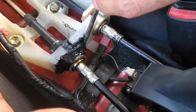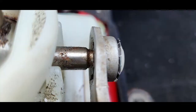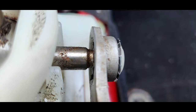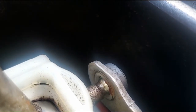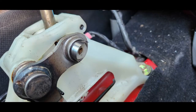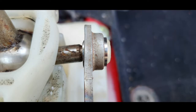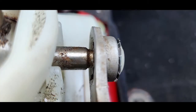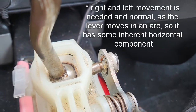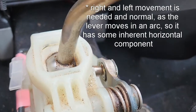By now I've driven with this modification and I'm much happier with the downshifts, but I can still do better. When moving the shifter to the right and left endpoints, especially reverse, I noticed that the bushing in the crossgate lever is worn out slightly and moving up and down. This needs to be fixed before I continue to make the shifter plate. Instead of replacing it I tried this method: I have some scrap feeler gauges and found one that can just barely slide into that opening. I cut out a semicircle and pushed it inside — I didn't have the right size for a full circle, but this will suffice. I then cut tabs into the ends of the strip and bent them so it can't slide out. This fixed the up and down play almost completely, which translates to a few millimeters of improved precision. Some time later this hasn't slid out of place, so I'll stick with this fix.